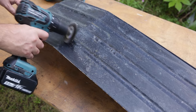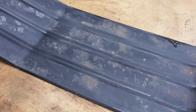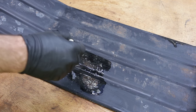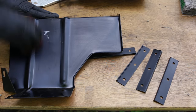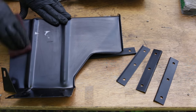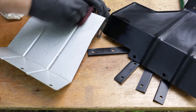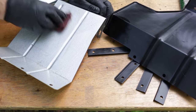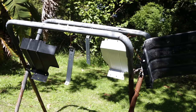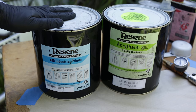But there was some psychological reasoning going on here. I'm trying to not let this quick repair get out of hand, so it makes total sense to spend longer doing a worse job, just to avoid this turning into a full-blown project. The new black parts just need a quick scuff — they're usable as is, but since I'm painting the other parts, I may as well spray these as well so they match. The galvanized parts need a good scuff with Scotch-Brite soaked in wax and grease remover. Since I have quite a few parts to paint, I went through the hassle of getting out the spray guns, and I'm using the leftover paint from the other chassis.